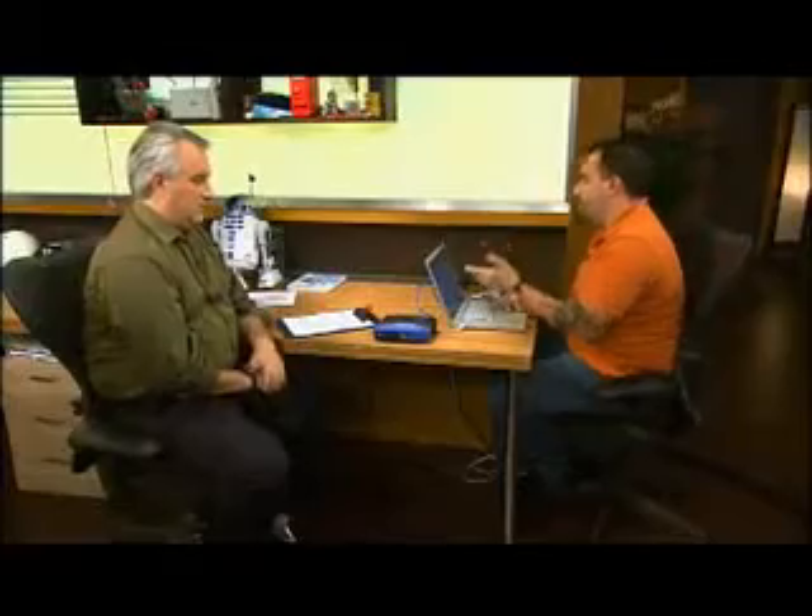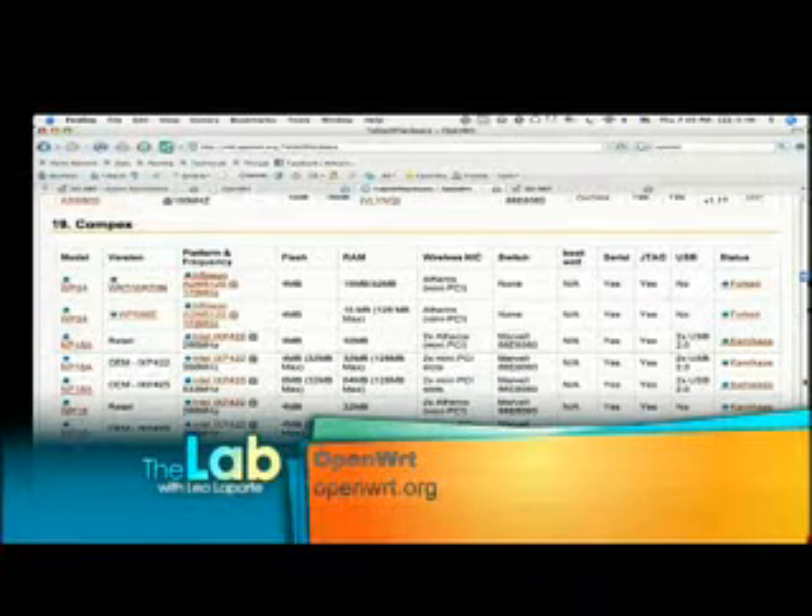What do we do first? We want to modify this router. The first thing is you want to make sure your specific model is supported. On OpenWRT's webpage on their wiki, there is page after page after page. They'll tell you on the side whether it's untested, supported, or experimental. If it hasn't been tested, it just won't work — you might not be able to flash it, or you might brick it. Worst case scenario, you've got a $60 piece of junk. But the listing is really accurate — if it says it can, it will work.